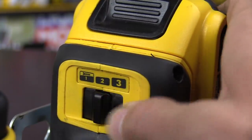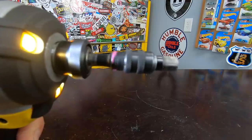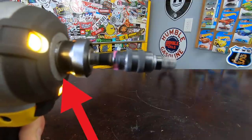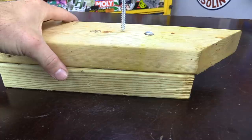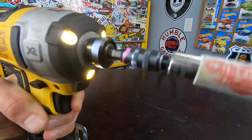I really like the bigger button for changing modes, so that if you're wearing bulkier gloves, you can do that without taking them off. There was one issue I ran into — and I don't think it's a deal breaker for me, but it may be for some of you — and that is that the bit actually wobbles quite a bit inside the drive. You can see here, way slowed down, that bit's kind of walking all over the place, and the more weight you put on it, the worse it gets. Typically I have the tool on the stock before starting and work up to speed, so it's not too big a deal. But if you're running screws into wood, that might be an issue, and I also worry about it causing extra wear long term. Doing things where you need speed and precision could be an issue, though while using it on a car I didn't really notice it that much.